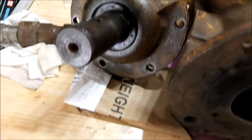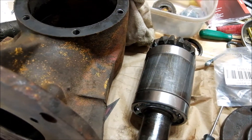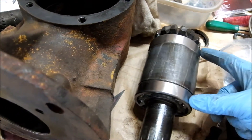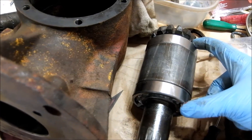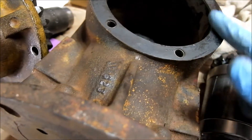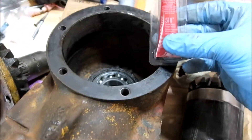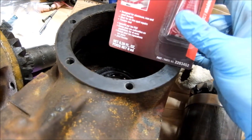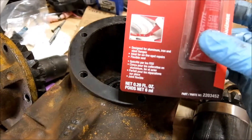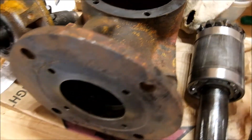I like to use grease to assemble mine for the double-lip seal purposes. Those pressed in there like magic. To recap: you have one 6207 bearing, three 6208 bearings, and one seal kit. As for gaskets, you're on your own — I did not find a good gasket, so I'm just going to use a flange sealer, not RTV. This is a little different — it's more specific to very fine clearances and tolerances.